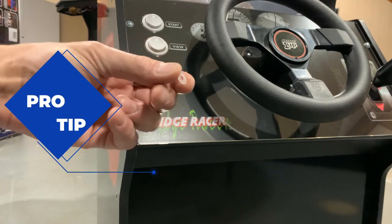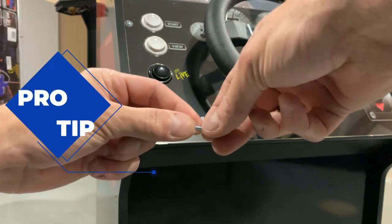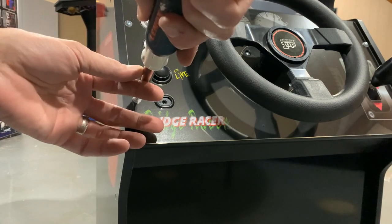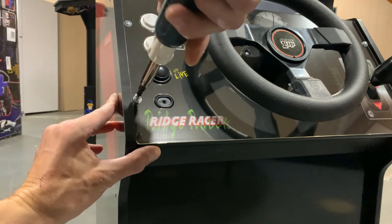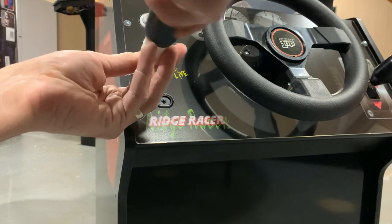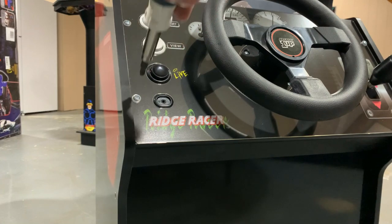And I have one final assembly tip for you. It's these plastic washers I bought on Amazon. The link for them will be in the description below. I use these specifically for the screws that hold down the control panel so that I don't crack my deck protector. If you do that, it's going to break your heart because you're going to look at that the entire time you own the cabinet. So these add just a little bit of added protection, and they will sort of curl up or concave towards you when you get your torque just right. So when you tighten it up and these things begin to curl, stop and you'll be good to go.